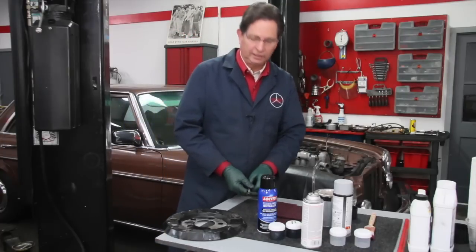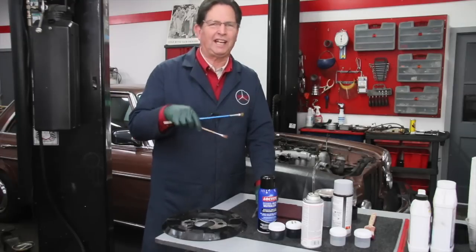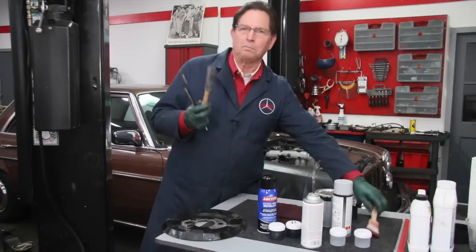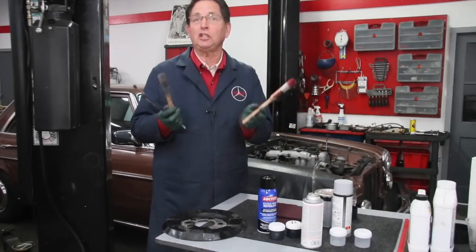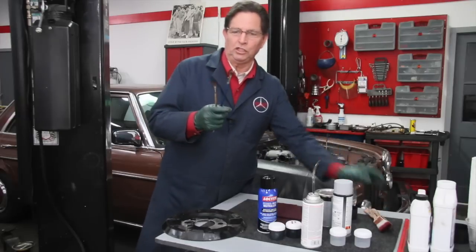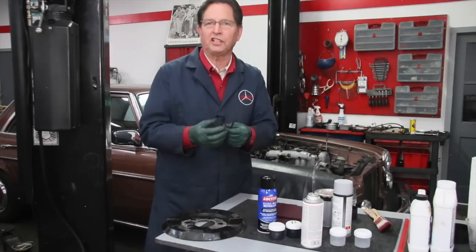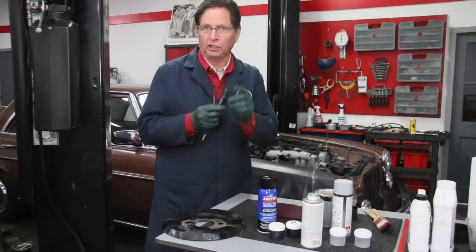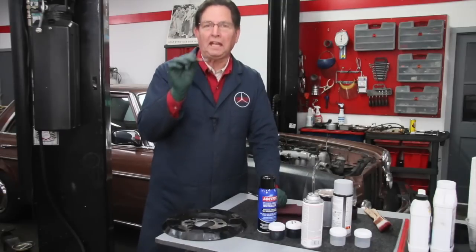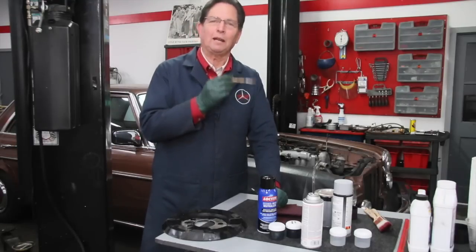As far as brushes, I've pretty much found that the smaller brushes work better. You're working on so many different tight areas and varying surfaces — trying to go in with bigger brushes when painting and detailing an engine block, you're going to get paint on stuff you don't want paint on. When you do go after your brushes, you want quality brushes that are real thick, with a lot of bristle to hold a lot of paint, so when you dab those spots you'll get enough paint on and get it to flow out. Let's go over to the engine and I'll show you how it looks now.